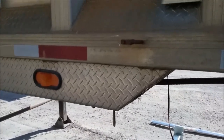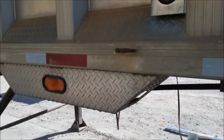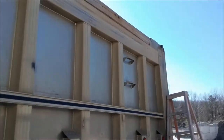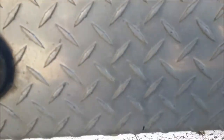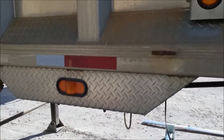I'm looking at installing the undermount spring assemblies for an Aero EZCover system. This is a frameless trailer, about 34 foot. I found my pivot point — the location where I'm going to mount the pivots, the springs. You can see that little black mark there, then straight down below it — that's my second point, so that's where I'm going to mount my pivot point.